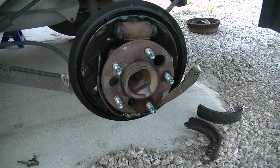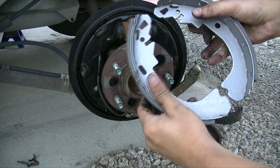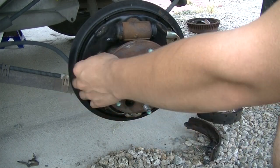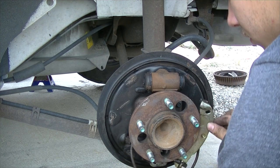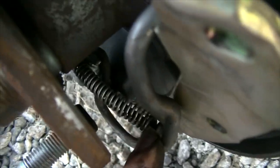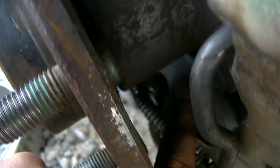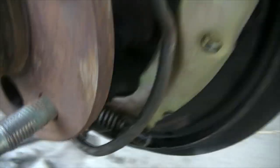After cleaning, go ahead and put the hardware bar back on. The pads are both identical so it doesn't matter which way they go. Set the bar in place behind your emergency brake with the tabs going towards the inside of the car. The spring needs to be going closer to the tire and the bar goes behind that piece. It goes from that side to that side.